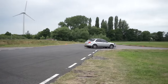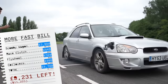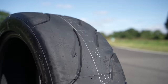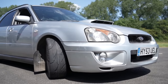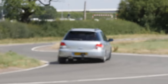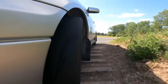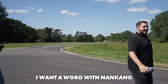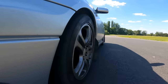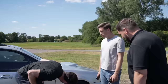Shiny new coilovers had exposed the next weak point: the old, worn and cheap tyres. You could see the tyre just folding under the wheel when heavily loaded. We actually tested three different tyres: a budget tyre, a high performance road tyre, and a semi-slick track tyre. We went for the semi-slick, though it did take some adjustment with pressures to get them working. Nankang also recommended negative two degrees of camber. The ridiculously sticky AR1 tyres cost us £600 but shaved just over two seconds off our time.